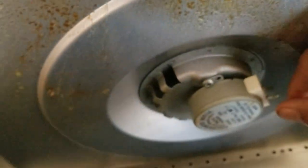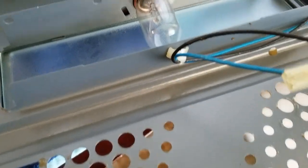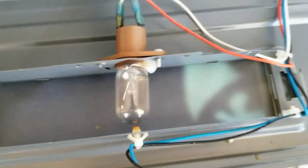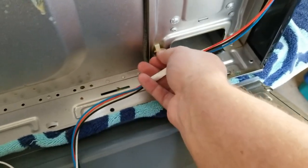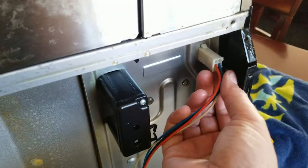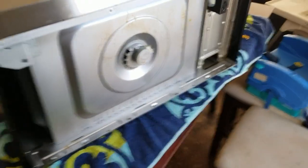There are two wires that go to the rotating carousel — those just pull right out. Further down there is the utility light, and I'm going to clean all that grease off. This unit mounts to the wall above the stove, so that light illuminates the stove top. I was going to take the light loose but it was on there pretty good, so I found a harness over to the right that I could take loose and unplug from the connector at the top, then take that whole piece away to the side. Once unplugged I wiped it down with Clorox wipes.